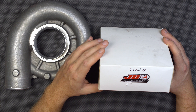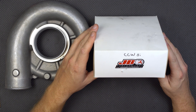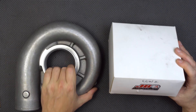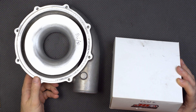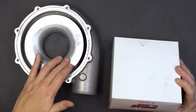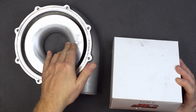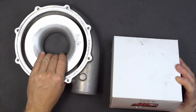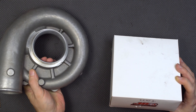We were going to do all these different tests, but then what happened with my dad threw a wrench in things, so I figured we'd just go right for the gold standard. What we have here is an SI volute — this one is a blem from John. It was one that actually touched down, and they smoothed it out in here. When an impeller wheel touches down, it kind of friction-welds itself to the surface. They buffed it out — it doesn't really change the geometry and won't make any difference. Plus the price was right.